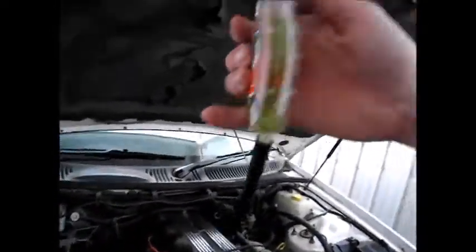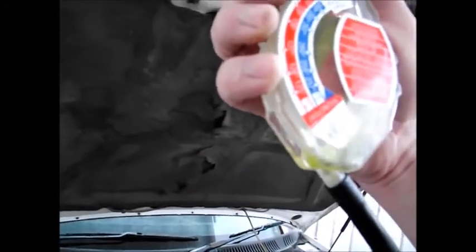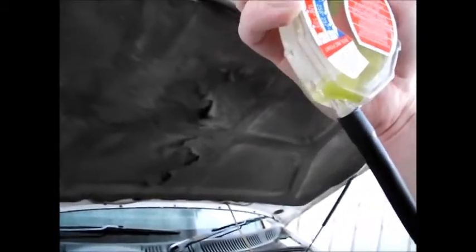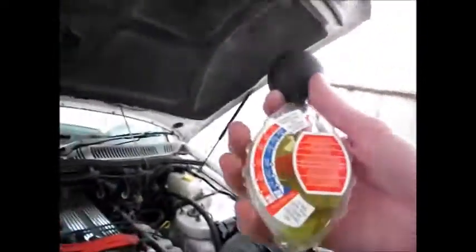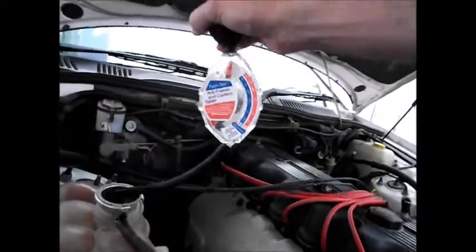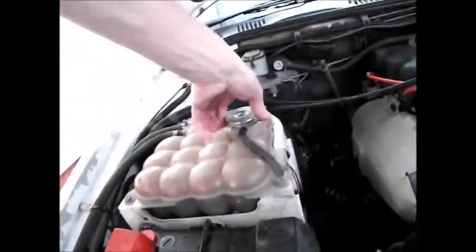But that's how to use a coolant hydrometer — it gives you the instructions on the back. Remove cap only when radiator is cool. Run engine to normal operating temperature. Draw up fluid level to line. If dirty or rusty — which this obviously is dirty — drain and flush then refill cooling system. Tap lightly to remove air bubbles. Top of pointer must be vertical. Large pointer shows degree of protection. Flush with hot soapy water to rinse clean — that's the gauge itself, not your cooling system. This gauge needs to be rinsed out thoroughly with hot soapy water, then rinse clean with water. What you do with the sample is put it back in, without immersing the hose again — and the basic reason for that is coolant is poisonous, and children and dogs will drink it because it's sweet. So replace your radiator cap.